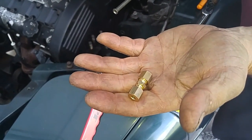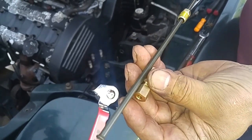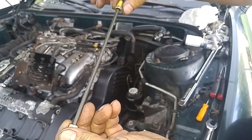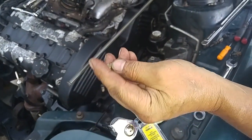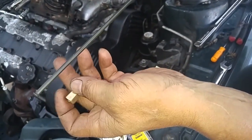We're using this compression adapter to join this with the old tubing. We'll cut it, bend it, and join it. We don't have to do any custom flaring. This tube is already flared on this end and we got the new flare nut, and when we join two pieces together there's no need to flare — we just cut the ends off, make sure they're the right distance, and then connect the two together.